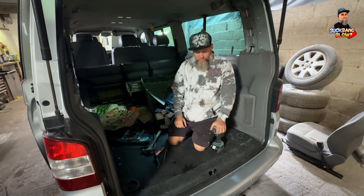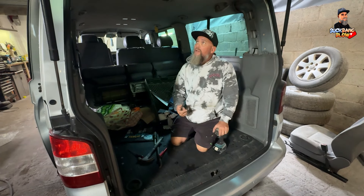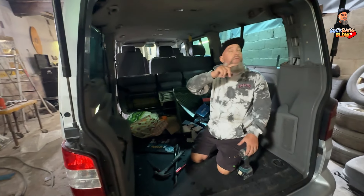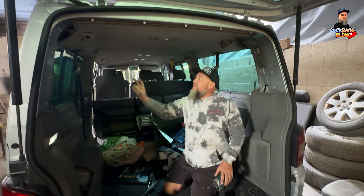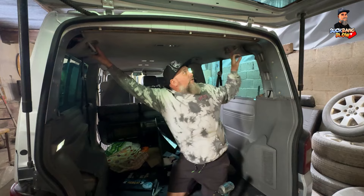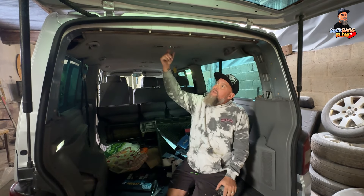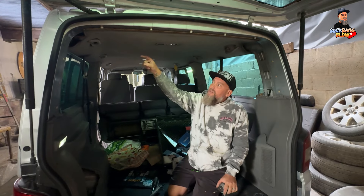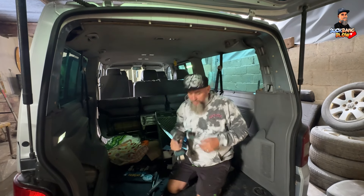So now I've got the boot open — which was just a hammer — I'm not going to tell you how I got that open because that was a bit of a mess. I've just took the two side panels off, so that one's now off and that one was just unpopped. You need to take off the handles on both sides, which is just a couple of screws underneath. Then I can drop this panel down to gain access to the inside, where the wiring goes and the bolts that hold the tail bit on.